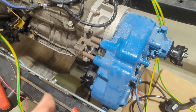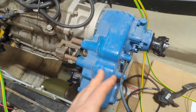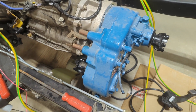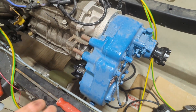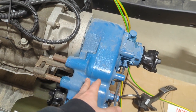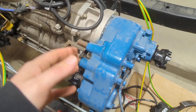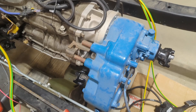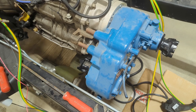So there are a couple of options here. We already took this apart, resealed it, made sure everything wasn't leaking, and got it pretty much ready to go — so we thought. Then I went to go buy the shifter and realized it was basically the wrong type of transfer case. If you have the J-Style when you have this all taken apart, you can replace these rails with the T-Style rails, buy a T-Style Coyote swap shifter, and everybody's good. But in this instance we didn't do that — didn't know about it — and now it's all closed up.